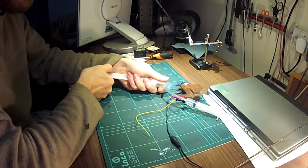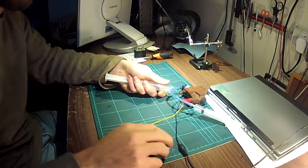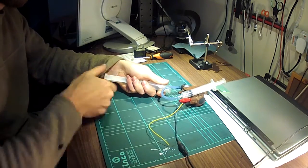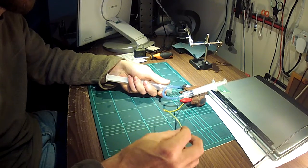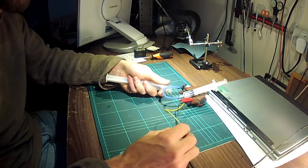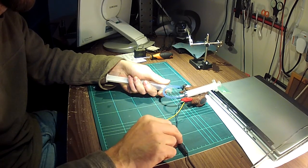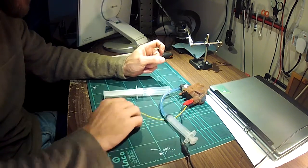When the ECU wishes to close the wastegate, it sends a signal to the solenoid. We put this side under vacuum — simulating the wastegate — and when the solenoid is energized, the wastegate should close. And there it is — that looks like it's working. Going to chuck the thing back on the car and find out.